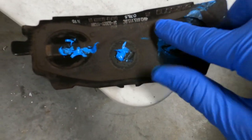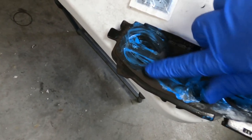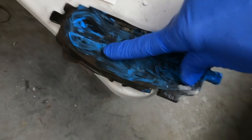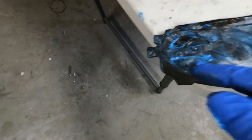Basically it acts as a lubricant, and this will essentially be like sound deadening to where these little metal plates don't get a bunch of harmonics — especially when they're cold — and create that terrible squeal. So we spread a thin layer around, coating the areas where these are going to move inside the metal tabs in the caliper itself. They'll slide inside these tabs, and with that coating the contact points can move freely and it prevents them from binding.